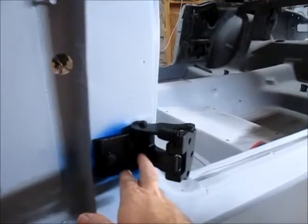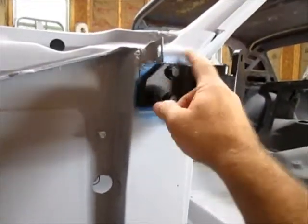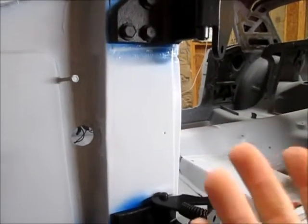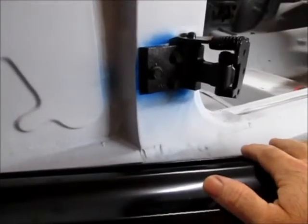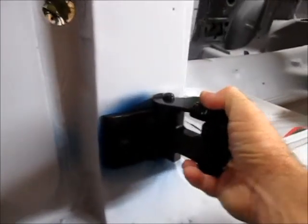I don't have any of the star-type bolts like I had originally. What I wanted to show you is these hinges — the lower one has three bolts and the top one has three bolts. There's a little metal plate that rides inside the A-pillar, and that plate can fall down pretty easily. When the car is open with no dash, you can get in there pretty easily and put it in place with your hands. These are not tight — they still move.